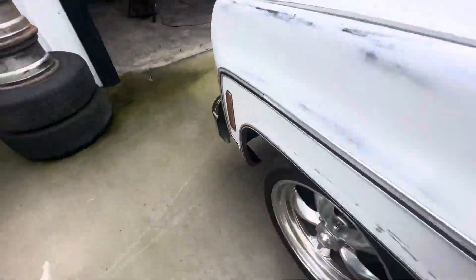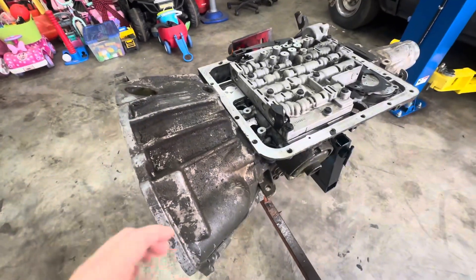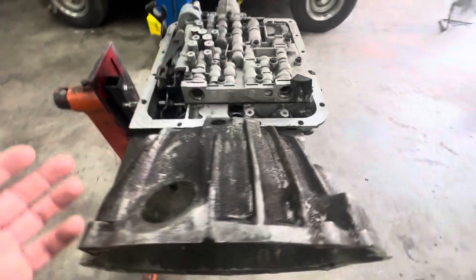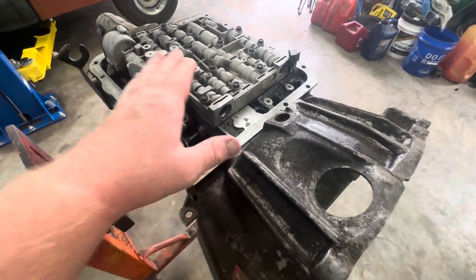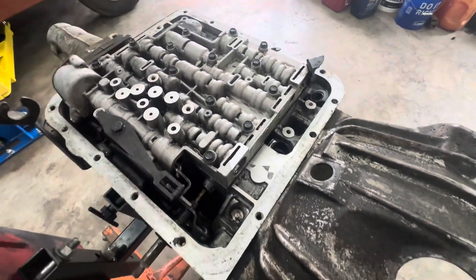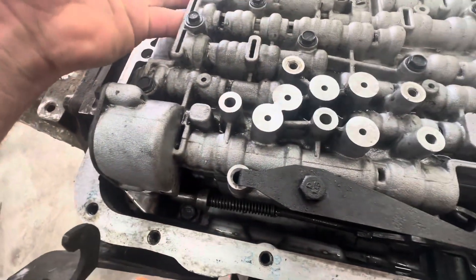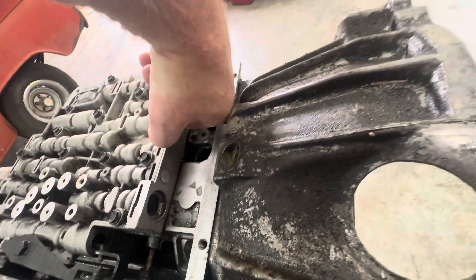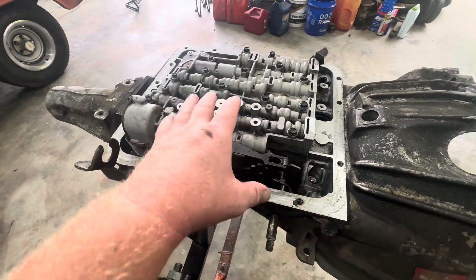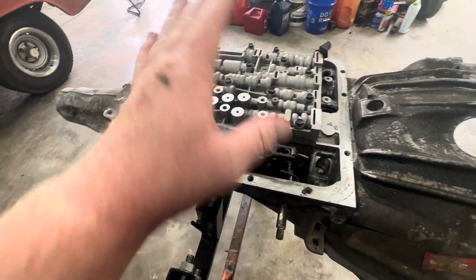You'll have to look over my mess, guys — I've been extremely busy. Here's the 4L60 that I'm going to build. I actually went and dug this thing out earlier. I had it covered up a long time ago, the tarp deteriorated and fell to pieces, and it was filthy, rusty, and nasty looking. I've cleaned it up a little with carburetor cleaner. Looks like I'm missing an accumulator, my shift solenoids are gone — every one of them — and the wiring harness is gone too. I've got another 4L60 four-wheel drive transmission I can pull those pieces from.